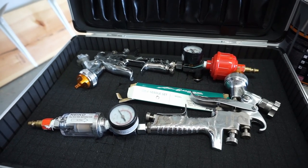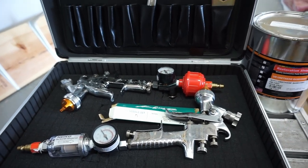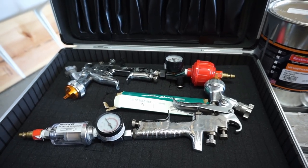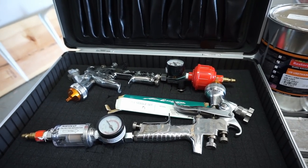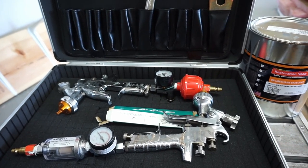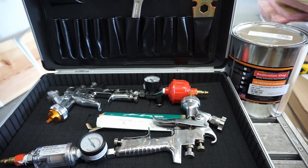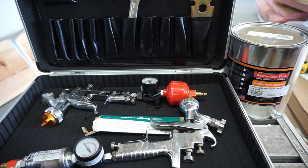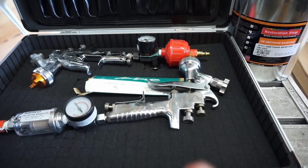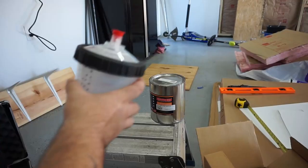On this particular setup I didn't have all my lines set up, so I didn't have the super long snake lines I plan to use in the future to really keep the air dry. It goes from the compressor into a water/oil separator, out to the outlet, then through a desiccant filter and the air/water separator before going to the hose. You want to keep your air as clean as possible from moisture when painting. The guns are set at about 28 PSI to spray.